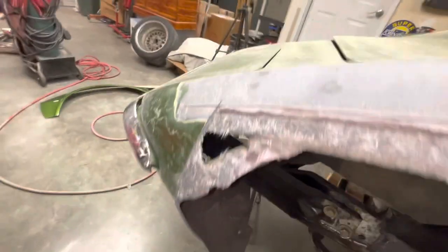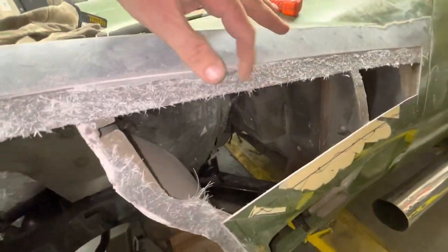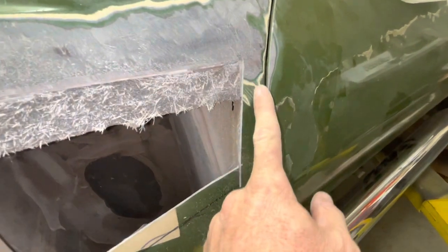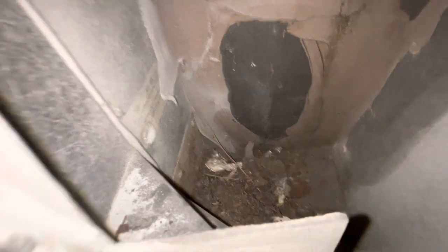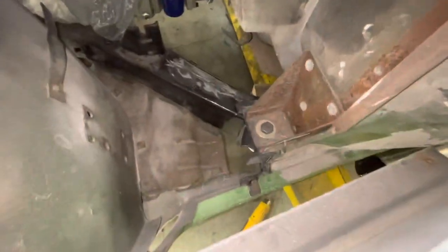Here's a good look at the bonding strips after the fender's been pulled off. There's a lot of material from the old fender still left on here — a lot of adhesive — it'll all have to be prepped. I did my best to keep the parting lines on a bonding strip, or at least somewhere I could easily get a bonding strip installed. There's a small inside corner panel, and it came off relatively easily — about 10 to 15 minutes. There's a bonding strip area on the jam area but I left it. On the backside there's a metal plate that's riveted and it looks pretty clean — I thought it was going to be worse. There's also a lot of burrowing material from rodents in there, so all this will get cleaned up.